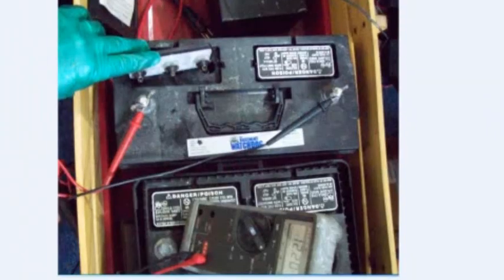The next cell shows the same characteristics. You have to do all six cells. What I've seen over the years is that when a battery goes bad, one cell will be totally off — usually that tells me the battery has been frozen, abused, or there's been some internal damage to that particular cell. If you see them all within the same range but one is way out of the ballpark, that's a good indication that cell is bad and the entire battery is bad. In this case, after sitting for two days without being charged for a long time, it's got about a 50% state of charge and it looks pretty decent. I put the cap back on — I've now measured the state of charge for that battery, and that's the best approach we can take.